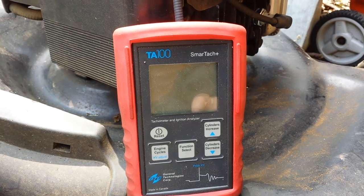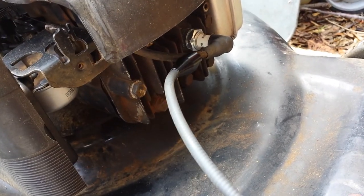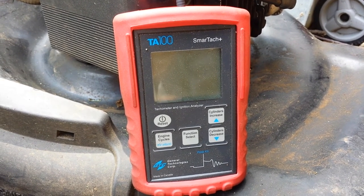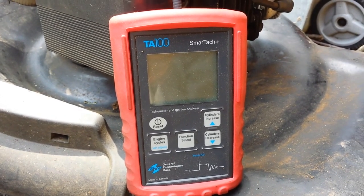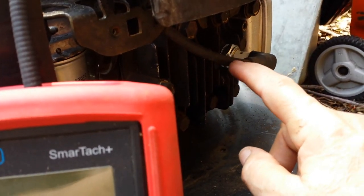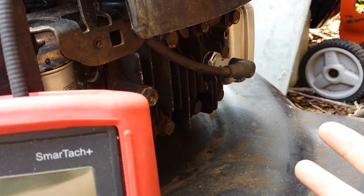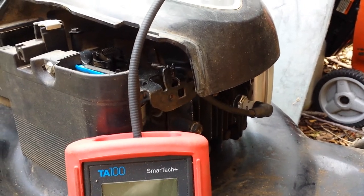The particular device I use is a digital tachometer — a no-contact version where you hold the probe just anywhere near where the spark plug is and it will read out the RPM. That's good because if you go by your ear, which is okay, generally speaking if it sounds like it's running crazy fast, it probably is. You can buy less expensive types. A lot of places sell hour meters that work by having a wire wrapped around your spark plug wire, and oftentimes those little hour meters also double as a tachometer. So it's not a bad investment if you want to adjust this and you're not comfortable going by ear and you don't want to over-rev your engine.